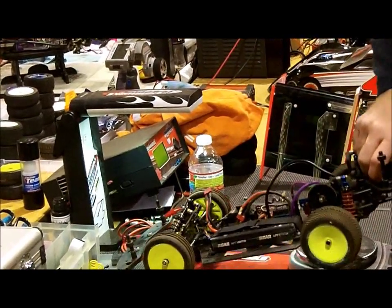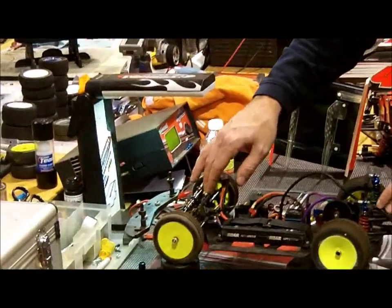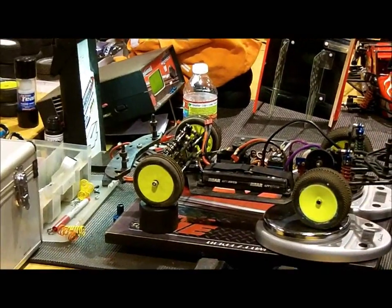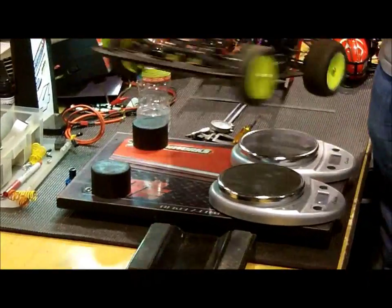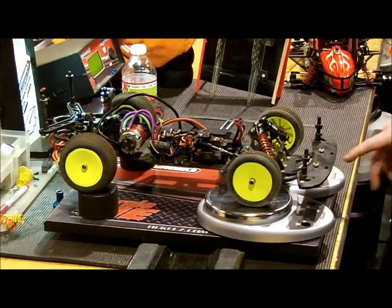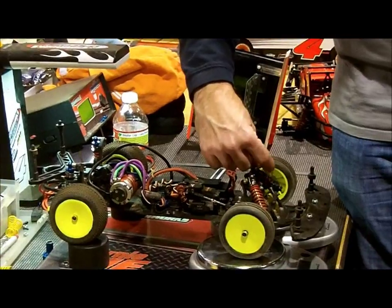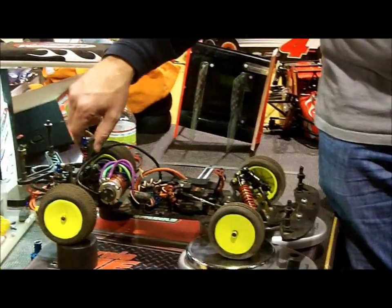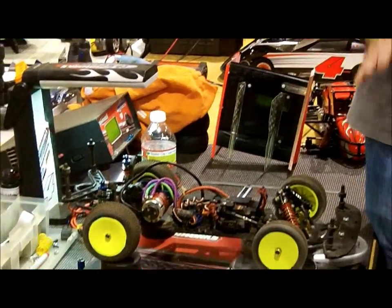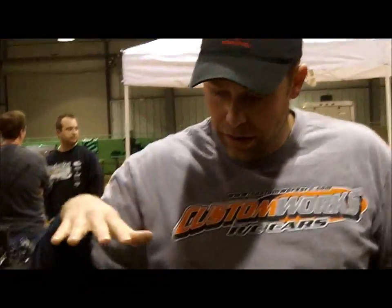Say, here, Nathan's gonna have a lot of wedge out of this. So if I wanted to equal up the weights on his car, equal to the front, it's 14 over here and 8. So what I would do to do that and keep the ride height equal is I take one out of here, put one in here, put one in here, take one out of there. So for each one you push down, you release, and so keep that same, think of it like keeping a table level, but you're going to change which corners of the table are holding all the weight, and that's how you'll jack the weight to keep the ride height the same.